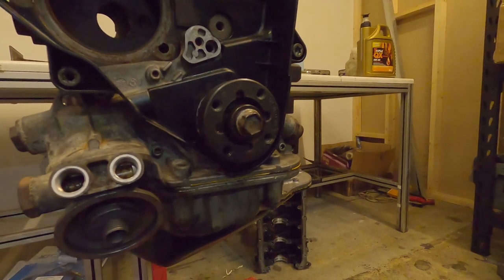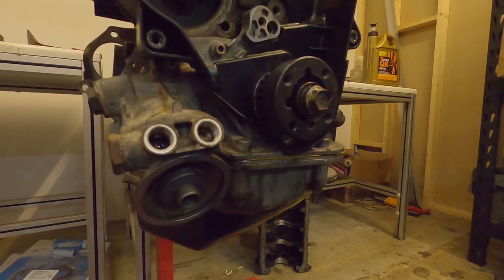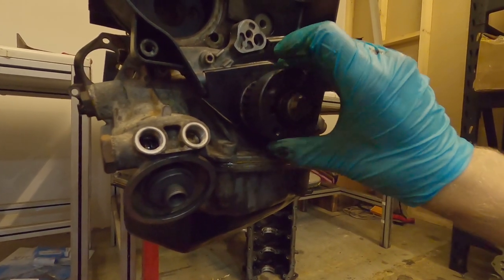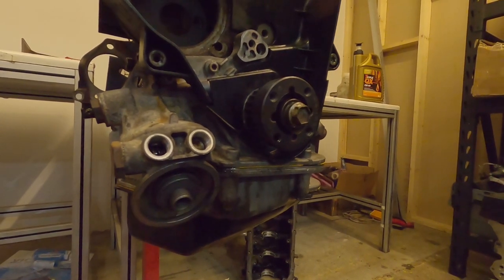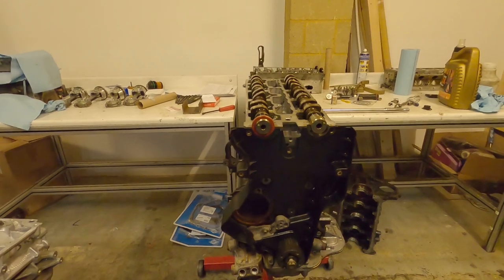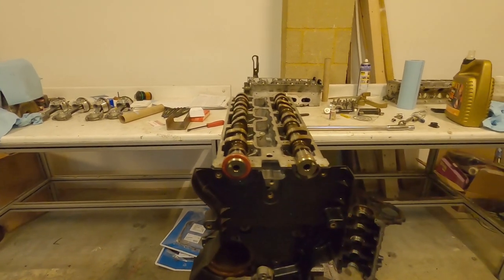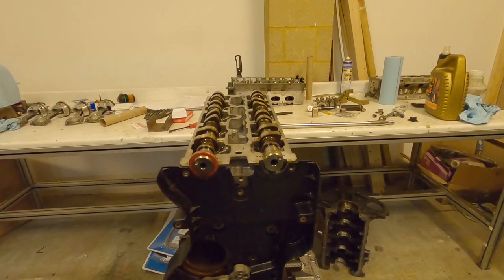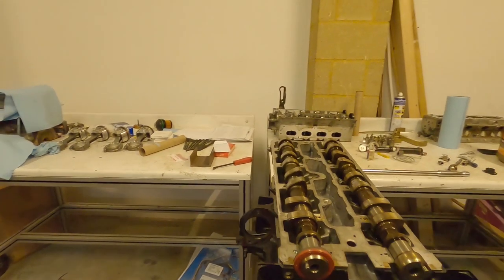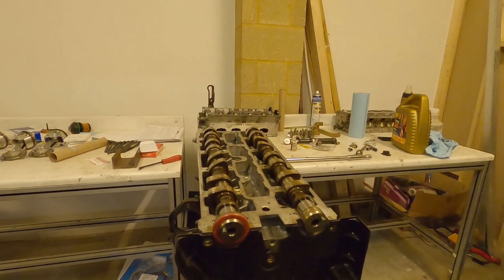So that's our pulley installed. Because we've left our pistons in the recessed position, we don't want to tighten this up now as we'll move our crank. I'm going to leave the bolt sticking out so it's obvious it's not done up — the last thing I want is to leave it looking done and then forget to torque it to spec, because if your pulley becomes loose and starts to rattle on the crank, you're going to have problems. Unfortunately we have to leave it there for this video — it seems I've used one of the cam seals out of my last head gasket set, so I need to get another seal before we put the cams in. I've just put some oil over the lifters and popped the cams in with the seals ready, but we'll carry on with the next video and definitely make good progress.